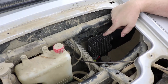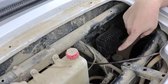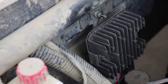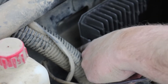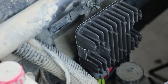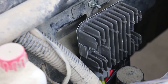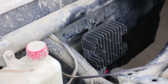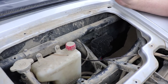Here's a shot of how we relocated our regulator using our relocation harness. We're up under the hood at the front of the vehicle. The harness exits the drive shaft tunnel at the very front and is routed up along the firewall. We said earlier to remove your original regulator mounting bracket — on this 2012 Razor XP900 four-seater, the bracket fits perfectly between two pre-drilled holes on the firewall. The bracket stands the regulator off the firewall giving good airflow. I can't confirm the hole spacing on other models, but I'd recommend reusing the original mounting bracket regardless, as it provides a good standoff for airflow above and below the regulator. Our harness gives you lots of options for where to put your regulator up front.